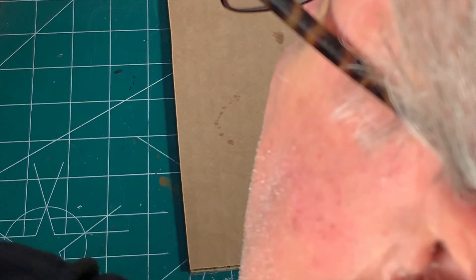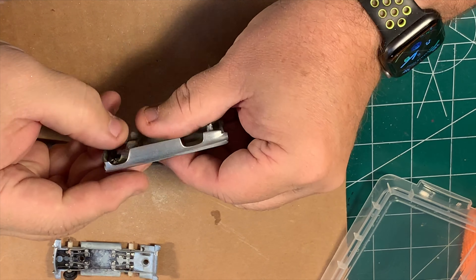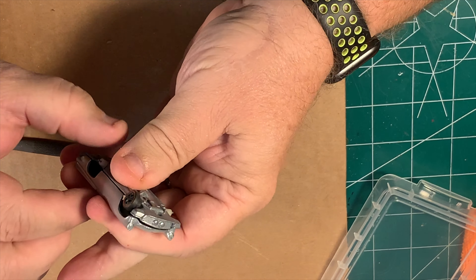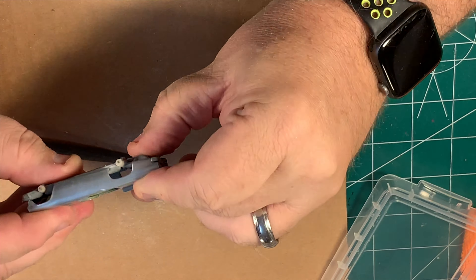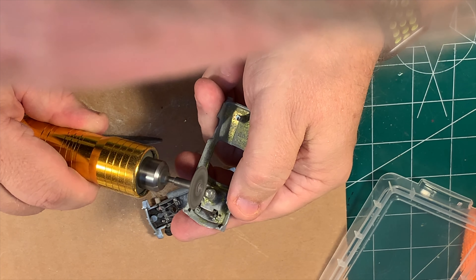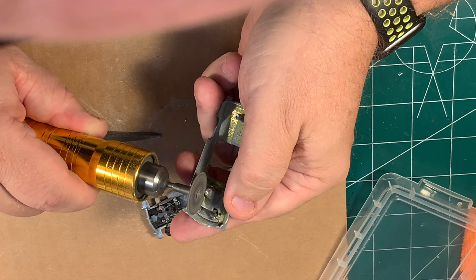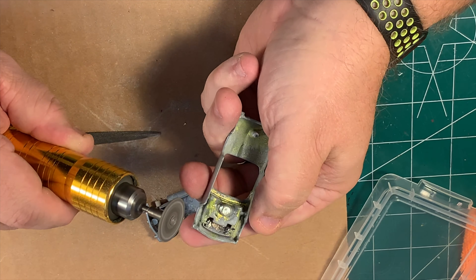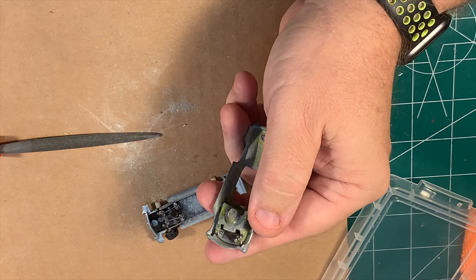I like to put a little bit of supporting material around the outside of the tube as well — that's just a matter of preference and how weak you think things are, but while we're here we might as well make this thing stand up good. Now's a good time to talk about one downside to this: we are adding a lot of material underneath the body of this car, which means we're going to have to do a lot of testing and fitting to make sure all the clearance we need is maintained. You may have to get creative underneath here with your files and your rotary tool.